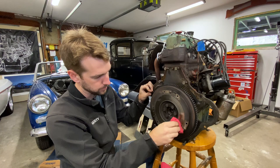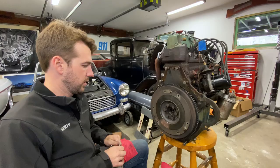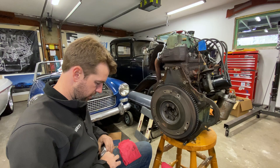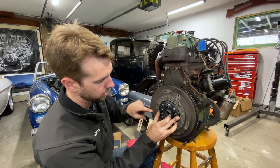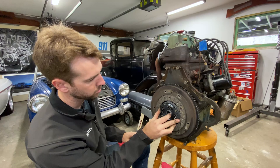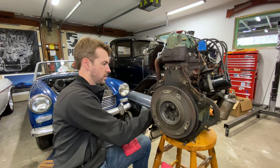I'm not actually crying off camera because I got brake clean in my eyes - there's no crying in car repair. Once I have the flywheel all cleaned up, I'm opening up my new clutch disc. Look at that beauty. It's going slightly thicker on one side, and I want to make sure to put that thicker side out towards the pressure plate. If I put it on the other way it hits all those bolts, so it has to go on this way. I'll use my plastic clutch alignment tool and sync that in.